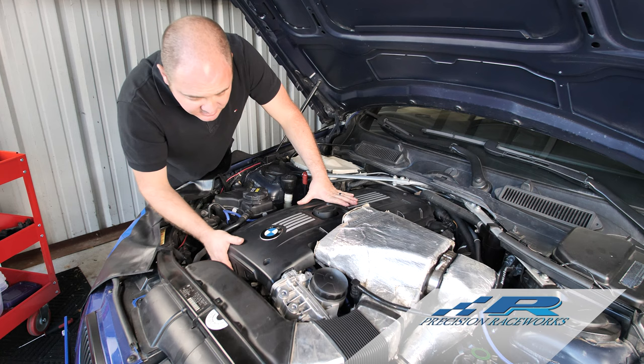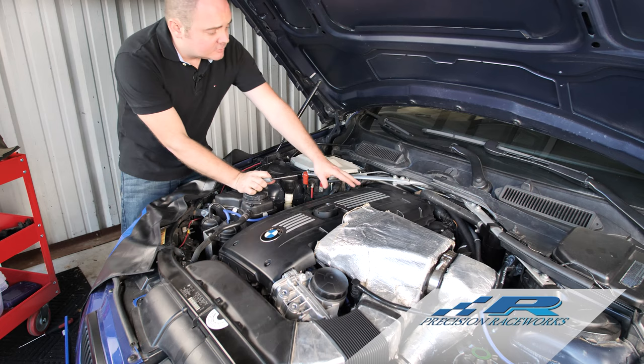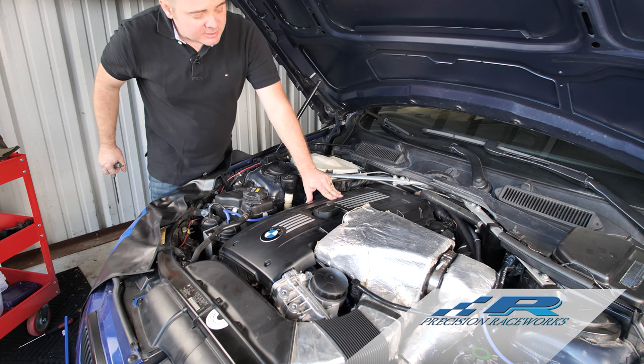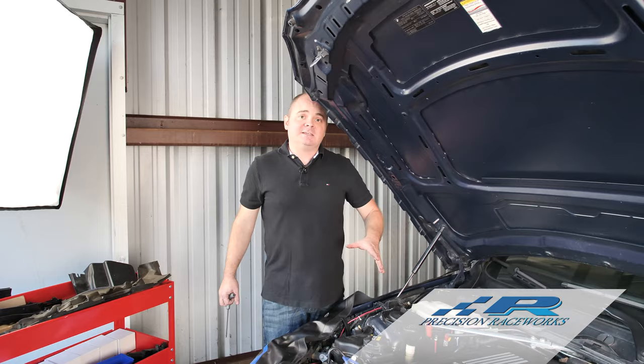Slide the cover back on — you can see it sits right back down, oil cap sticking up. Look at the front for your bolt holes — bolt hole one lining up, bolt hole two lining up. Get those front bolts on. You can leave the rear ones out — this customer already had theirs out — or you can install them. The far back rear bolt won't fit because of the way the coils sit, but it's not an issue; if anything, it makes it easier.